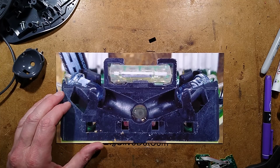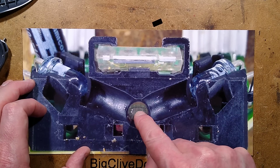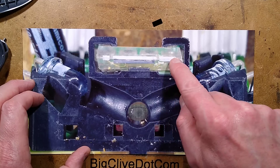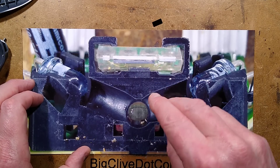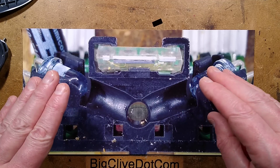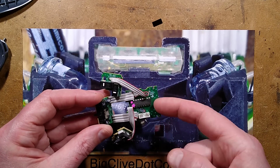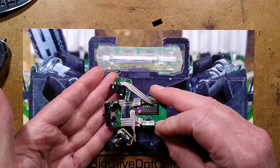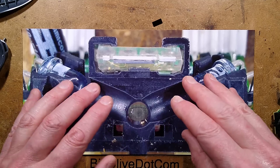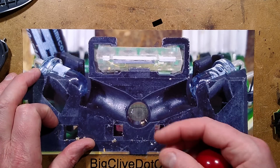Behind that is mounted the optical assembly. We have two infrared LEDs pointing in towards the focal point of the sensor — I say 'camera' but it's not actually a camera; it is using camera-type procedures but it's basically a sensor. It notes that the light goes in here and gets diverted, detects and takes multiple shots of what it's seen, and just compares them to each other, then sends data back regarding movement. It's all done on a single chip these days.